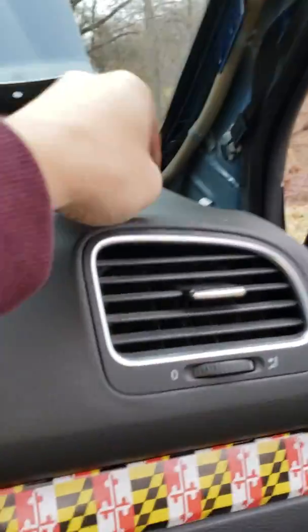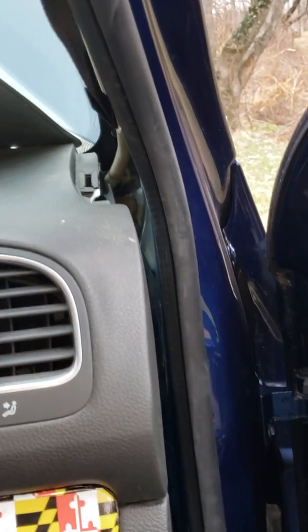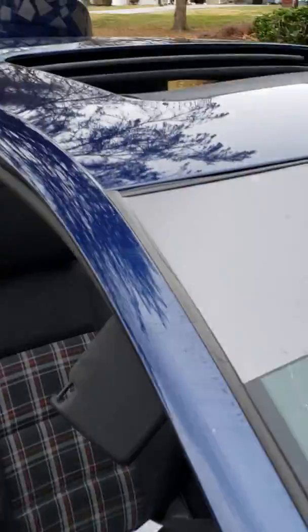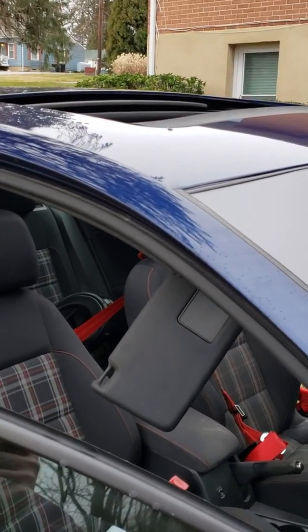So, I reconnected the hose back in here, and pushed it back in. And then I took a little bit of THHN solid wire. Probably better things to use, but this is what I had on hand, and I pretty much snaked it down through here and pushed it through, and cleared out basically all the little bits of dirt and debris that was still left in the tube and in this little end bit, and tested it with some water pouring down in the sunroof, and now it's good, and I have no more leaks or any more issues with that. So yeah.